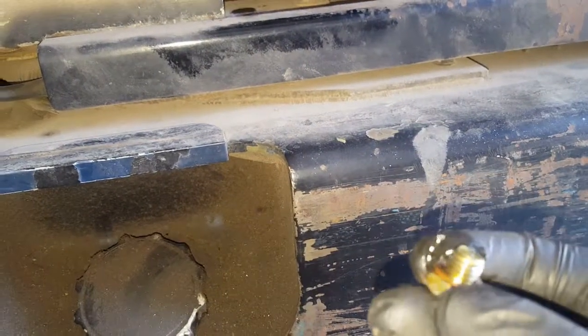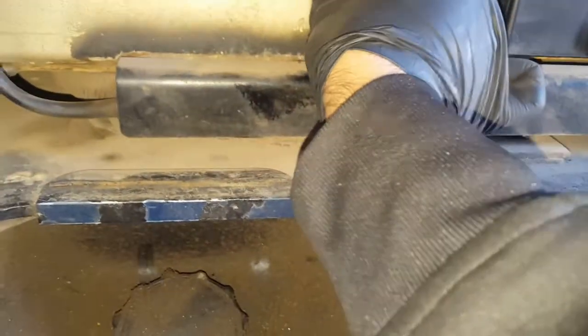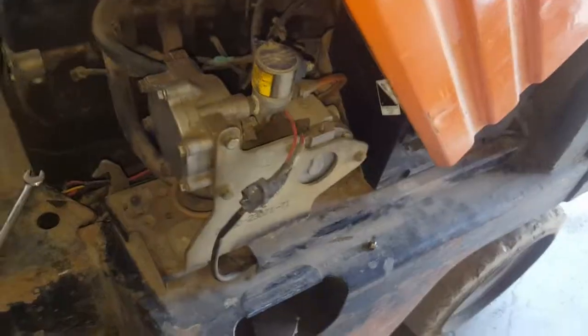Like I said, I already took it out and there wasn't much in it, but you can see all this junk on it — it's liquid now. This liquid becomes a wax and it does screw up the diaphragm. This can cause a no-start at times due to the wax build-up; the diaphragm will no longer open and close, allowing fuel to get into the system.